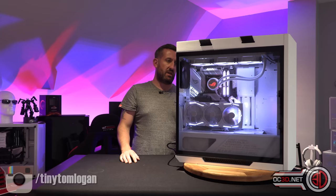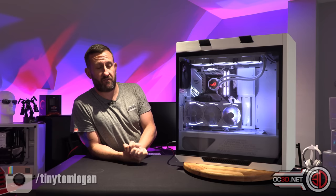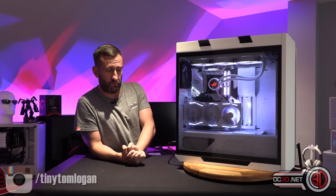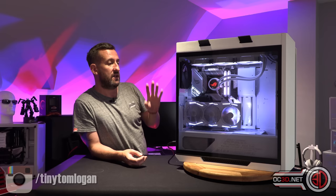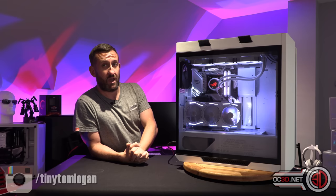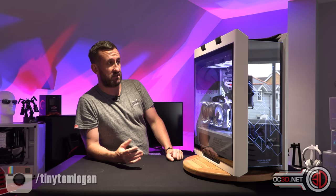Also, the CPU and the CPU cooler. There is a 10900KF in there. And what I went for in the end is I went kind of understated to keep the fan speeds low. So I went for 5 GHz, all core, which I got at 1.24 volts. And with Prime95, with the very top setting for heat and load selected, and then no AVX selected underneath. After 30 minutes of torture testing, the hottest core on the CPU had hit 82 degrees. But again, that was with the silent fan mode for the fans within the Asus AI Suite. So to be perfectly fair, for the fact it was so quiet, 80 degrees, I am actually quite happy with.